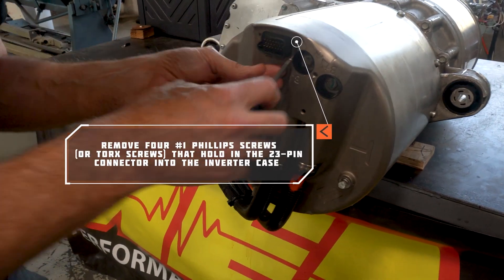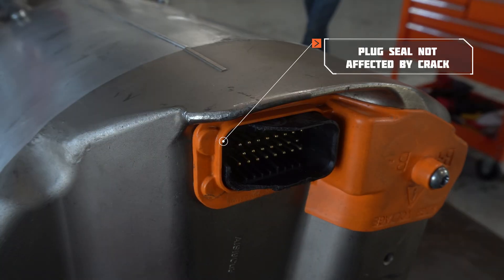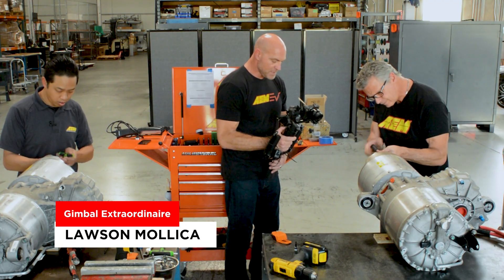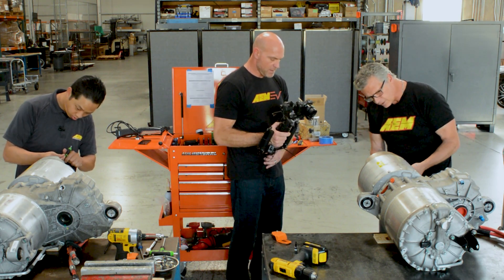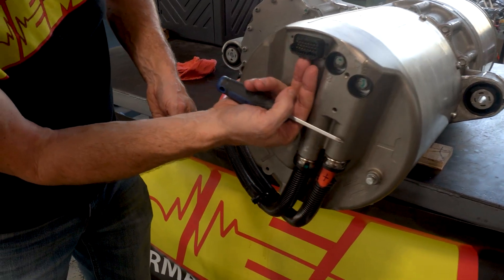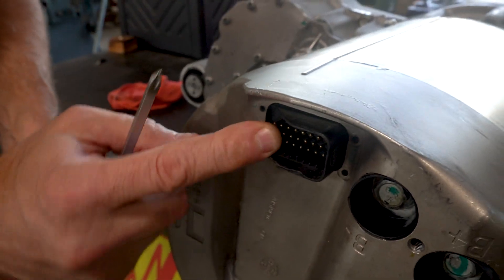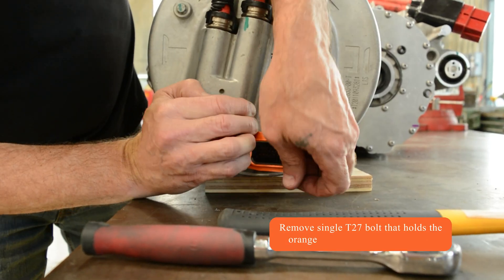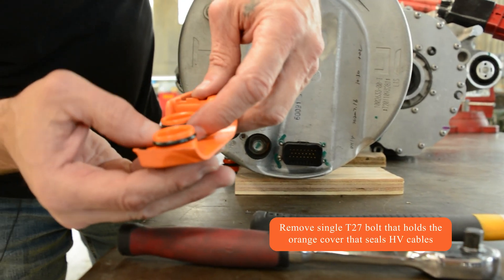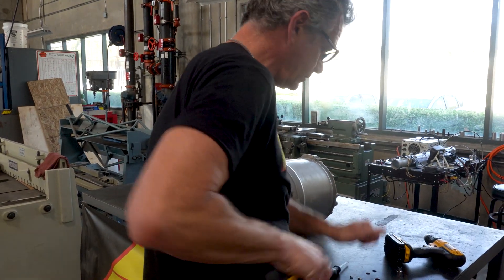We'll note that these were harvested from a salvage yard, so you can see the connector took a hit on both units — coincidentally, almost identical. If the connector is busted, it's actually not an accessible part. But as long as you have your retaining clips, I would run some dielectric on it and it'll still seal. Should be fine, and frankly, in this case it's not a wet weather vehicle, so I wouldn't be overly concerned.